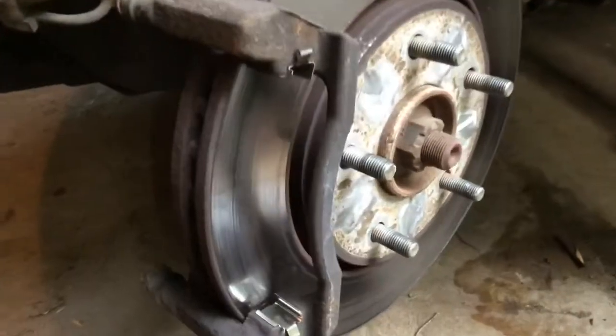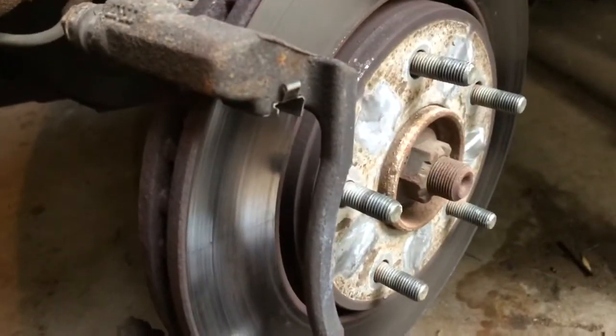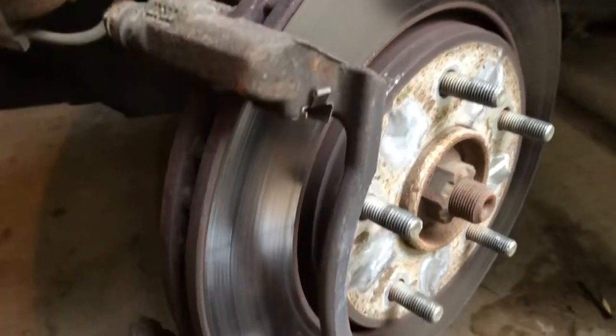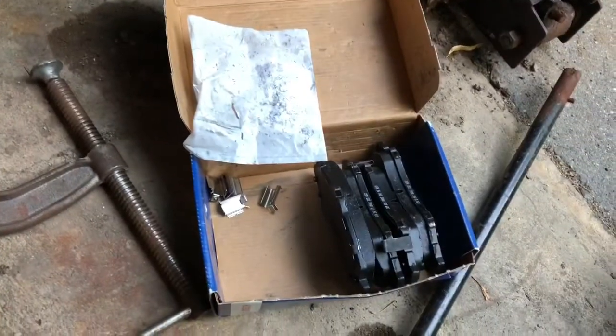Got the tabs snapped in place. Before I put those in, I took a screwdriver and scraped away a little bit of the surface rust on the inside so they go down to pretty close to bare metal. They give you a little packet of grease that comes with it — I'm gonna go ahead and cut that open and put a little bit in each of these slots, then slide the new brake pads in.